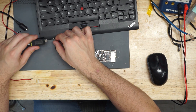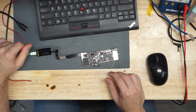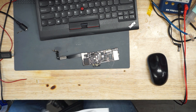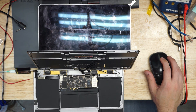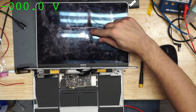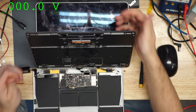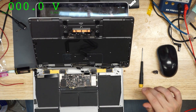Let's see if this turns on. If it does, we're going to do a little bit of shopping for a new computer. It looks like it's probably turning on. One way to find out is to plug it in and see if we get a picture. This would mean that the 12-inch I chose was an easy one. Plug in. Show me an Apple logo. Taking 0.5 amps with no battery plugged in — which is a good sign. An Apple logo! You work! Fixed! Have you run into any repairs made impossible by the T2 chip? Not yet, because I haven't worked on many of them. It works! It's fixed! This MacBook has been fixed — an A1534!